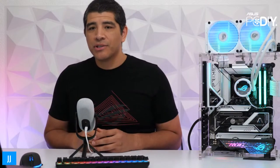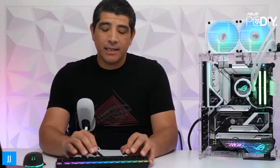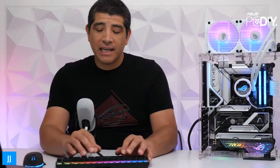And when you talk about DRAM scaling, we get a lot of people that ask questions about running two DIMMs or running four DIMMs, and why can't I run X different speeds in one configuration versus the other configuration. The important thing to keep in mind is that ultimately this comes down to the way that the memory controller works, and rank, density, and population all affect your scaling with your memory.